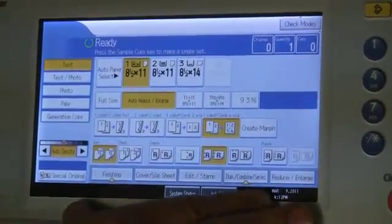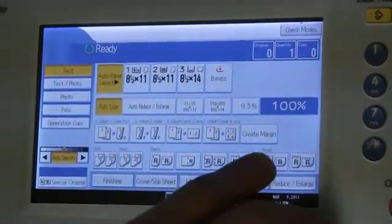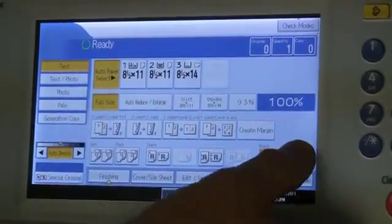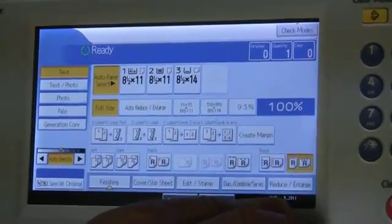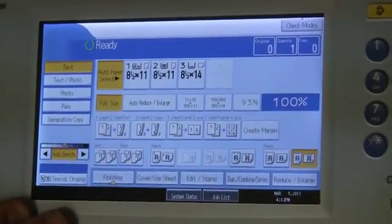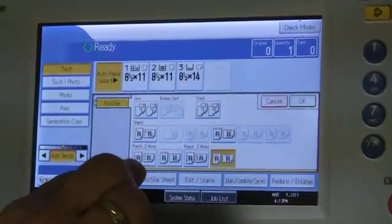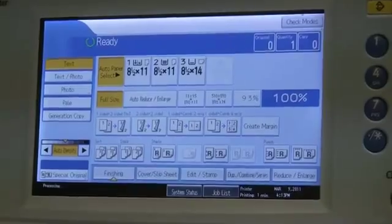Now your machine also has a three-hole punch, which is over here. This being the most common — it will put three holes on the left side of the paper. This one here will change the orientation if you feed it landscaped. Now if you decide you need two-hole punch, what you'd have to do is go into finishing. At that point you'll see an option right here for a two-hole punch. Just select it, say OK, and now the machine knows it's a two-hole punch.